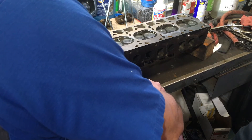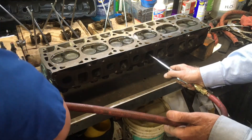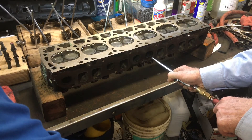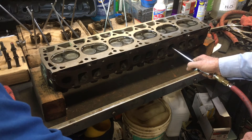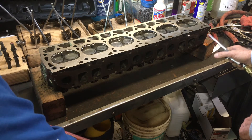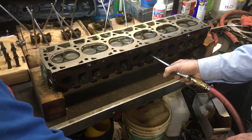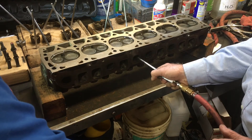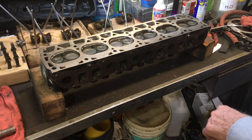We've had no air bubbles on most of them. There are air bubbles on this one — we're going to take this one back apart. That's what we don't want. So out of 12 valves, this is the only one that fails that test, which is actually really good — one out of 12. We'll take that one back apart again, relap it, and take a closer look at it to find out what happened to it.